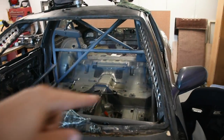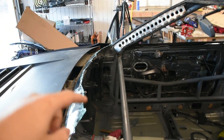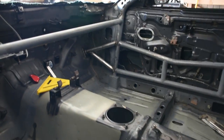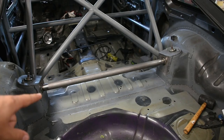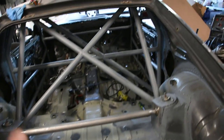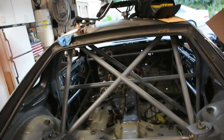On the cage, I still had to do the anti-wheel intrusion bars, which I was hoping to finish that night. It's actually been a day later now — I finished the anti-wheel intrusion bars on both sides, so the cage is done and I can start the paint prep work and start spraying inside and in the engine bay. I also welded a tube across to act as a strut brace between the rear strut towers. The rest of the interior is done; I just need to pull the steering column, which I still have on there in case I need to roll the car around.